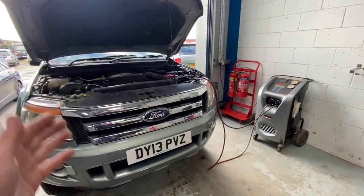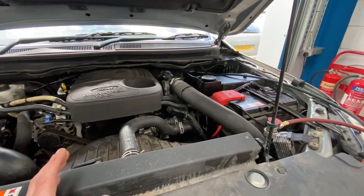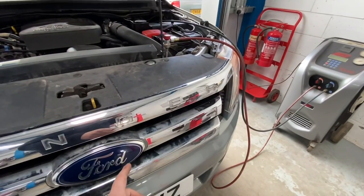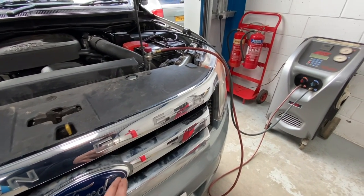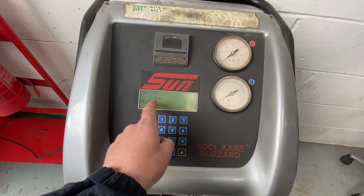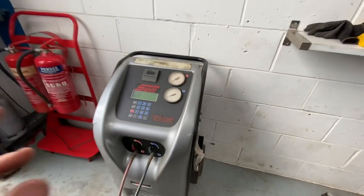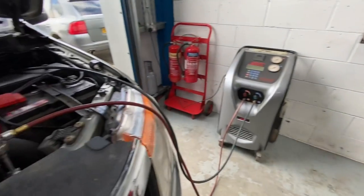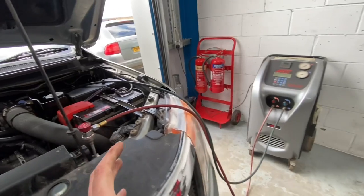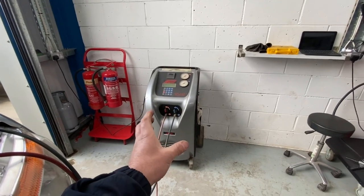I've arrived and it just seems to drive better and better every time I drive this truck. That engine is so quiet now — getting quieter and quieter the more we use it. We've replaced the air condenser which did have a tiny pinhole in it — that's where it lost its gas. The machine vacuumed for seven minutes, brings the gauges down to where they need to be, then holds a vacuum to make sure there are no more leaks. If it's happy, it does the cycle and recharges the system with the correct amount of gas.